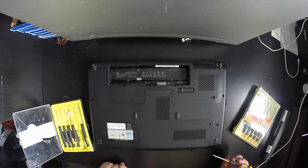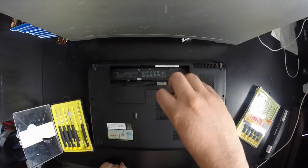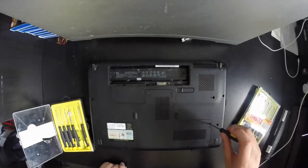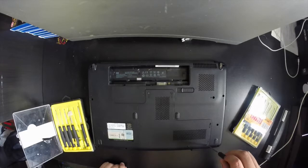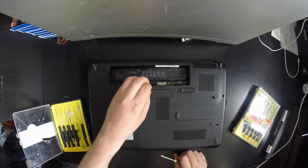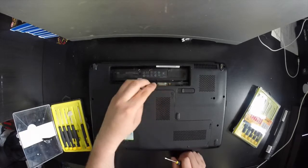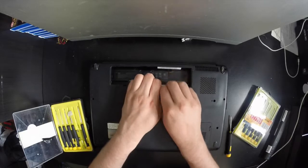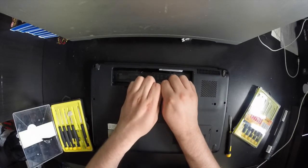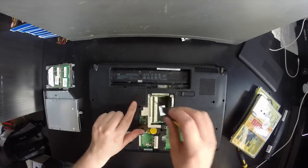As you can see, there are four screws around the case. Once all the screws are loosened, grab the panel at the top — it's quite firm because there are some plastic tabs, and you have to pull up from the back of the laptop. Give it a little tug and feel the panel just pop off.